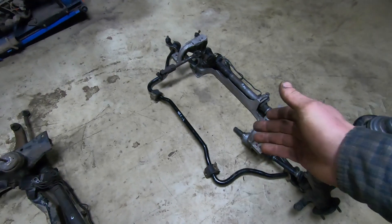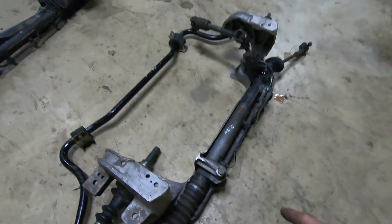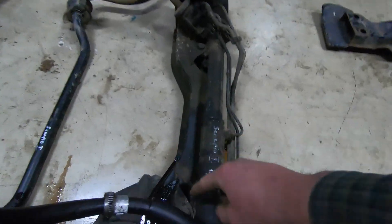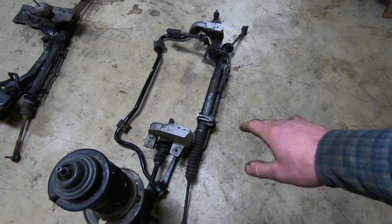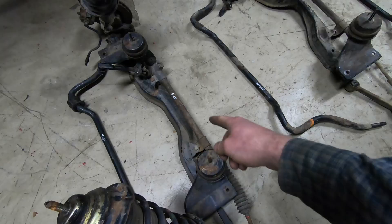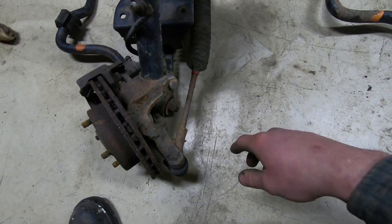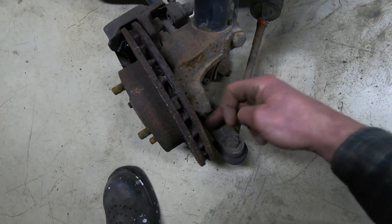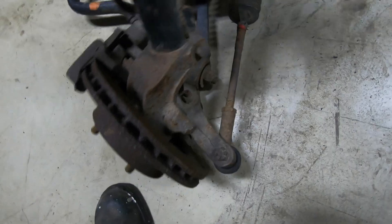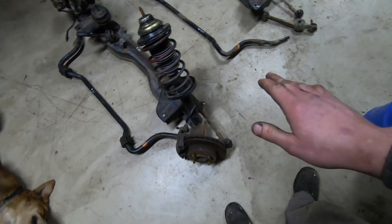And then we got the infamous XR 4x4 steering rack - this one is also different from all the standard Sierra ones because it's mounted from the outer side, opposed to the others that are mounted on the inner side. This one also wouldn't work on a standard Sierra without serious modification. And another thing: if you like to live dangerously, you can achieve the ratio change effect also by cutting and shortening the hub piece. What some drifters do is cut this away and shorten this piece - if that distance is shortened, it will act like a quicker rack. It's a viable option; many people do it and if it's welded properly it shouldn't cause any problems.